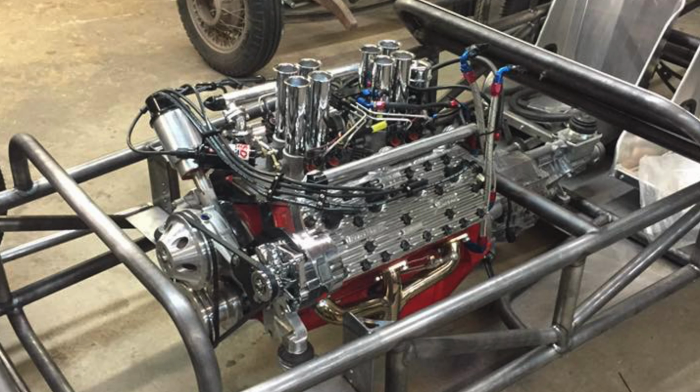And that's kind of the style we went with. It did evolve a little bit over time. Originally, it was going to be fully painted instead of left raw aluminum. That kind of changed towards the tail end of the build. But originally, it was powered by the flathead V8 that is now in the modified Roadster that I run at Bonneville and El Mirage. And it had an 8-port injector on it. We don't run the injector at Bonneville because it was an EFI injector and that's not legal in our class. So it had the flathead and a T5 transmission and we drove it all over the place.